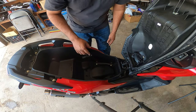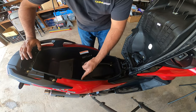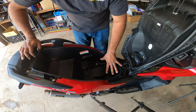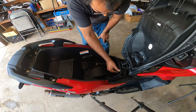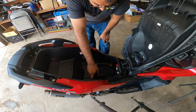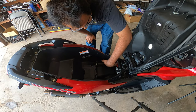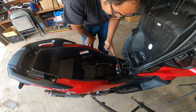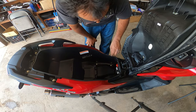And then you have trim panels — the little peg ones. You have six of those. Once you have those five bolts and the six trim panels removed, you want to remove the little battery cover right here. There's two 10 millimeter bolts here and then you have a Phillips screw here and here — and yes, this is for removing all of this.